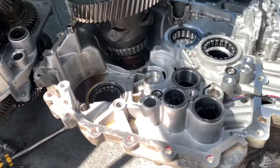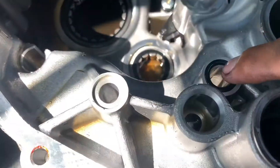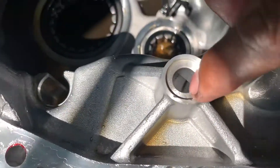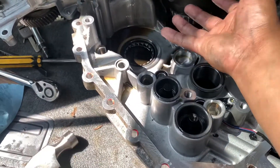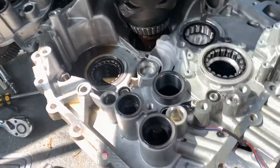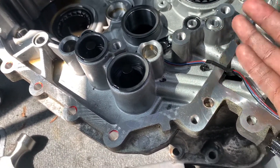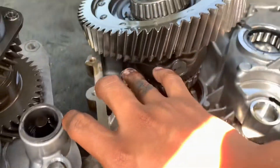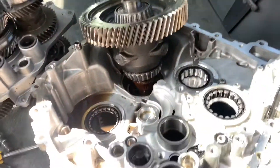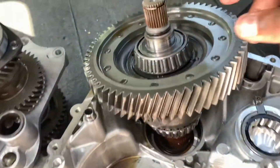I had a little bit of struggle trying to take this out. You can see there are some seals here — here's one, here's another one, and there'll be another one right here, a rubber seal. Once you take this out, you're going to have to kind of budge it — move it, tap it in from here probably slightly with a flathead and a hammer, somewhere here and there. There's the guide. Once you do that, it'll pry open and you'll get this part out. This will also come out too.